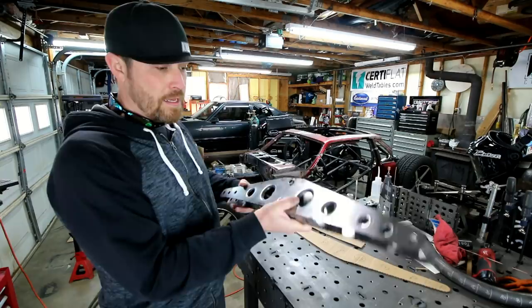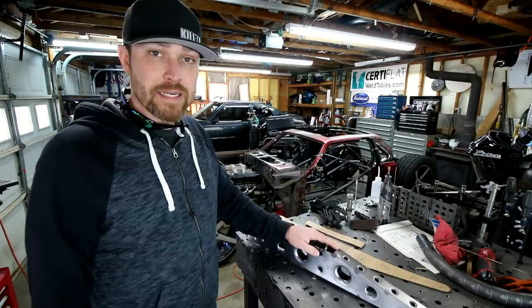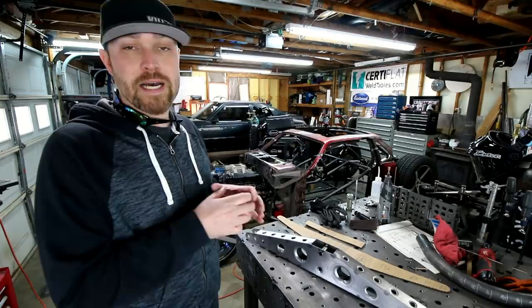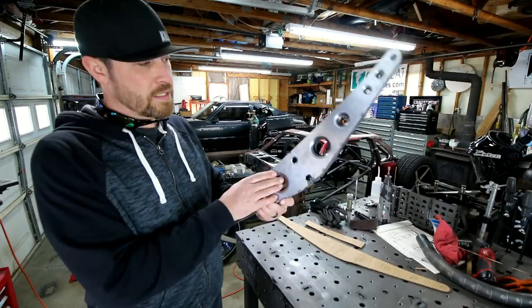And then I just bought a set of Eastwood dimple dies. These are the dimple dies that you use in a press. I've done a Friday video on a punch and flare die, which is for sheet metal, and then they also make a set of dimple dies. It's made to press in a hydraulic press. Puts these nice dimples in this stuff. Adds strength. You can eliminate weight by having these holes as well.